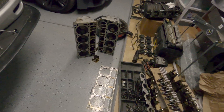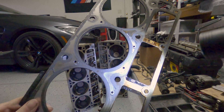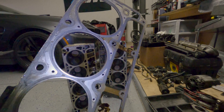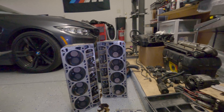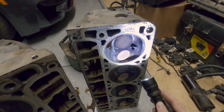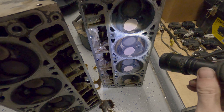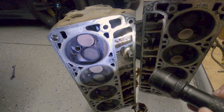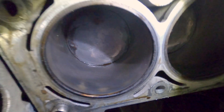After inspecting things extremely closely and doing another double take, the cylinder heads have definitely been off on this car. Looking at this head gasket, there's a date: July 31st, 2019. This car is a 2004, so these head gaskets are new and these heads have been off. I also noticed there are some surface scratches — there are a ton of surface scratches — and it does not seem like they took these heads to a machine shop when they put new head gaskets on. It seems like they just slapped new gaskets on and called it a day.